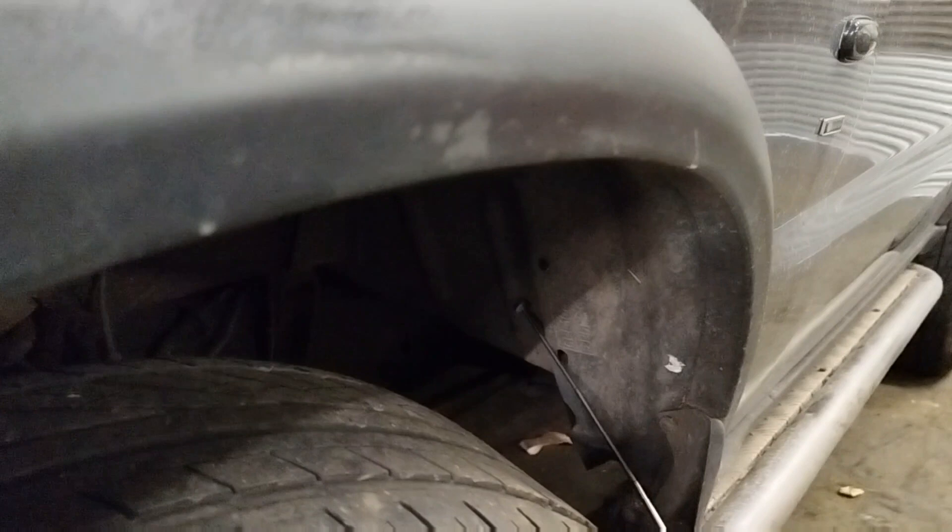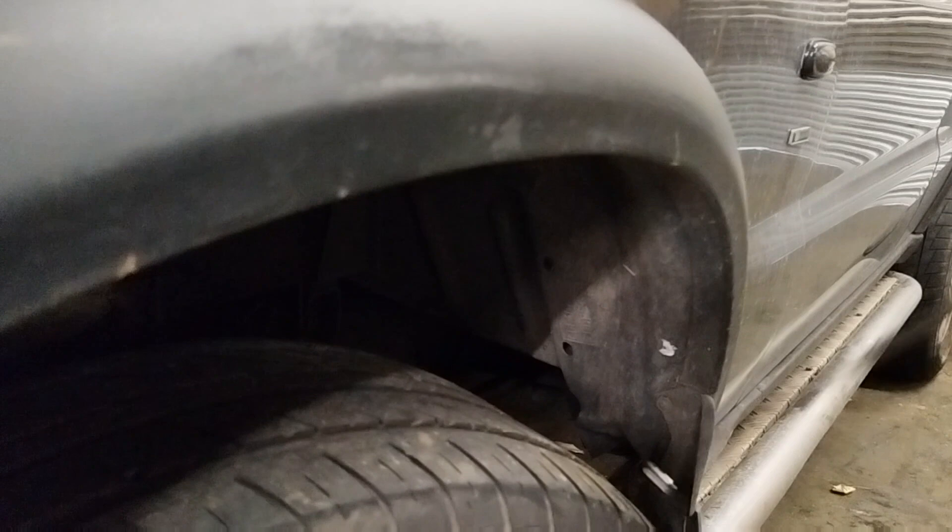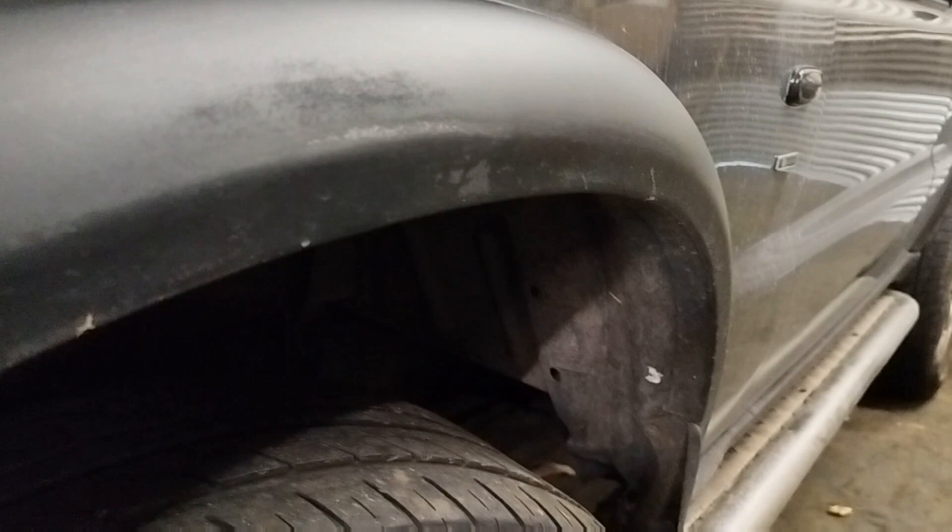You can also see the chassis from inside the wheel arch. The front of the chassis is 99% of the time alright — it's normally at the back where it's worse. But up in the arches, look around where it mounts to the chassis because they rust in that area. And just down in that gap there is a body mount — they go there as well. Check that, and also check you've got your wheel arch liner in there.